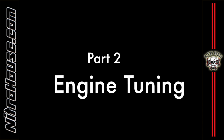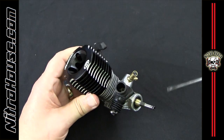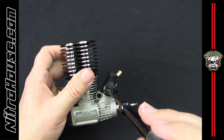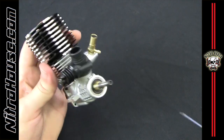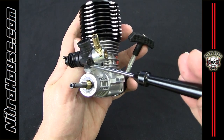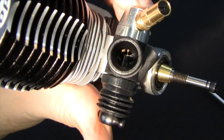Now you're ready to fire up the engine and hit the track. Part 2: Engine Tuning. The Hyper's engine has a carburetor with four adjustments. The main needle valve affects all the mixture adjustments on the carburetor. The low-end needle, located on the slide, affects the mixture from idle to mid-throttle. The large brass barrel screw on the side of the carburetor is set at the factory and should not be adjusted. The angled screw on the front of the carburetor is the idle stop, which will prevent the slide from closing completely and choking the motor.